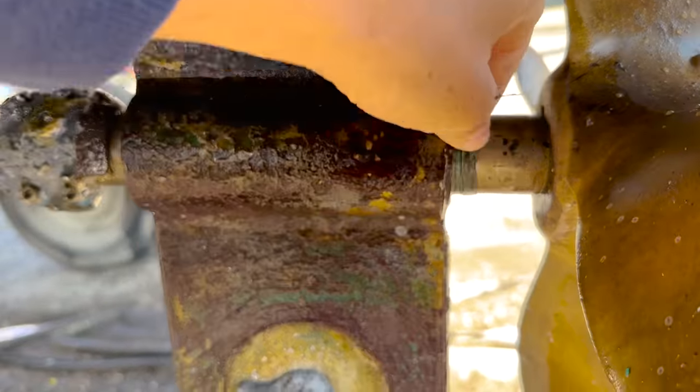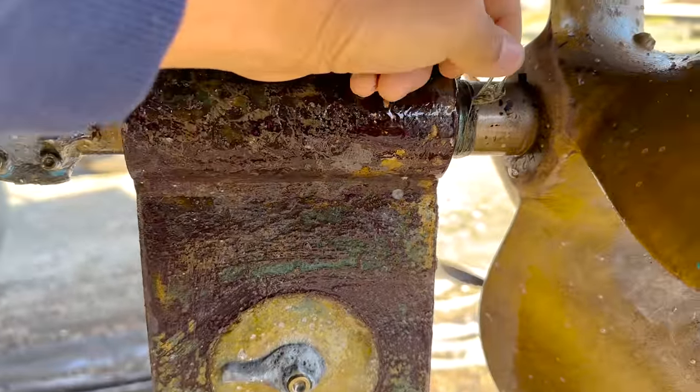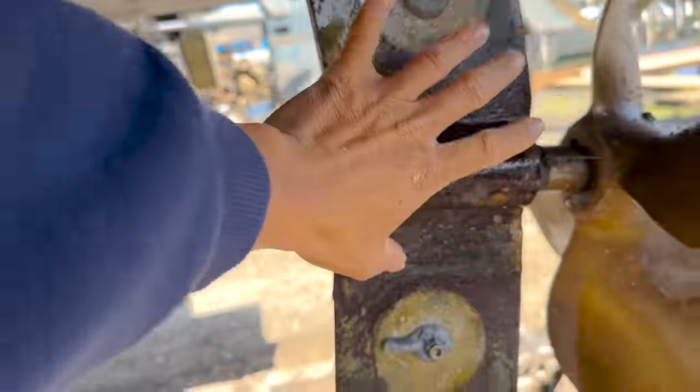It's that time of year — I'm getting the urge, we got to go crab. There's a little bit of braided fishing line on my prop shaft here and I definitely got to get that off. I'll tell you what, this braided fishing line plays hell on these cutlass bearings, which is the rubber carrier bearing that carries the prop shaft through your strut here.